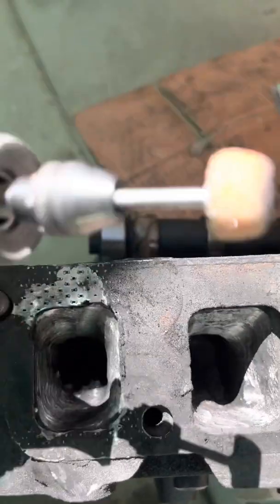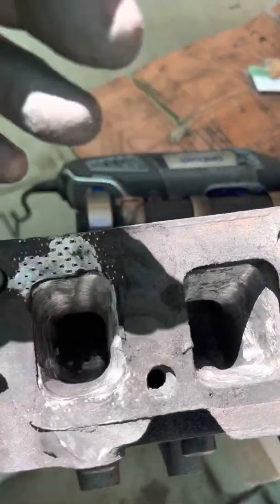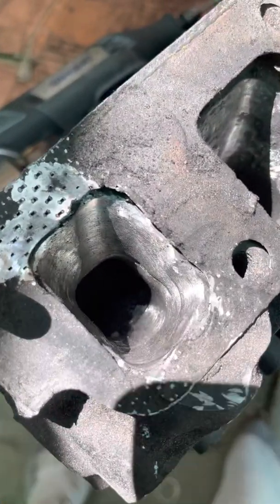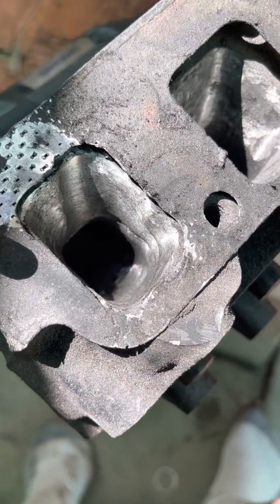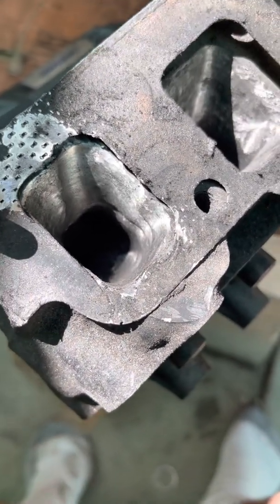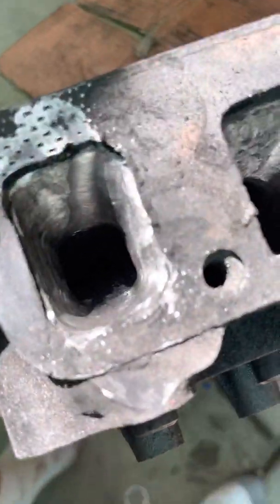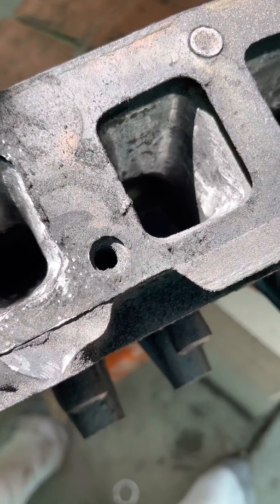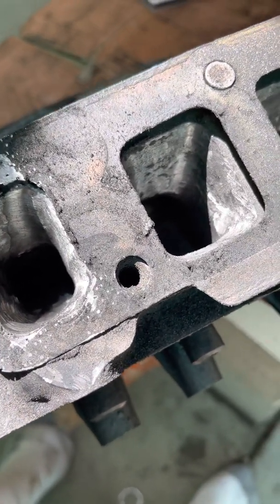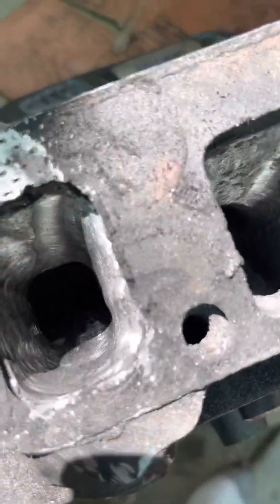You need just one of these kinds of tools, a Dremel or another brand, and I use large cylinder stones, because with the RPM held constant at, say, the high setting, the larger stone gives you a higher surface speed, or linear velocity, and that improves the cutting. But it takes more time than the intakes did. I wonder if it's because these ports were exposed to exhaust gas and the iron hardened, because it really took a while to cut them out. They cut slower than the intakes, that's for sure. Anyway, 5 more times and I'm done.